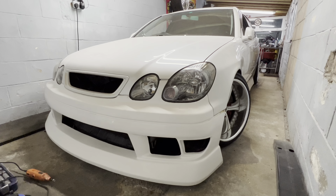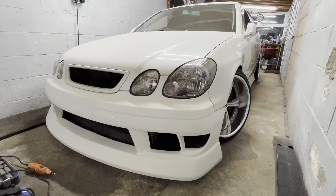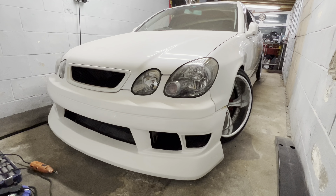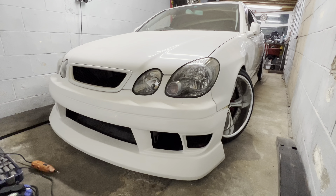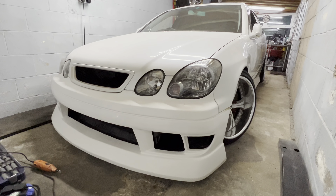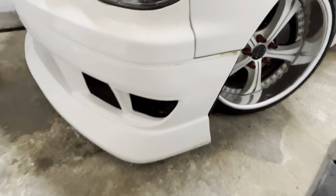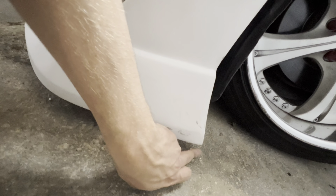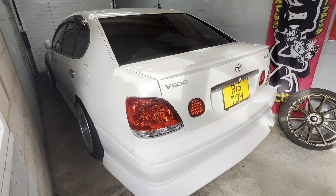So that's the front bumper all fitted up, guys. As you can see, it fits really nice — it's literally like OEM. You just have to be careful with this Desired Motor Factory kit because when the guy made it, he actually made it on 19s, and it's super low on 18s on the front. So if you can, you can get away with running an 18, but I would recommend the biggest tire possible because there's not a lot of clearance there.